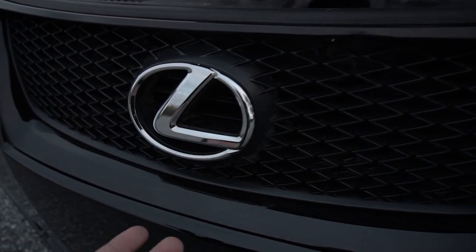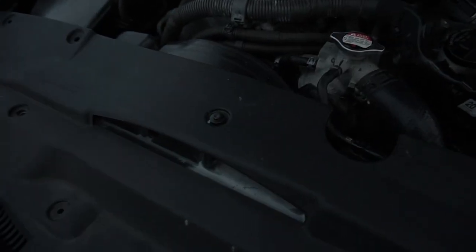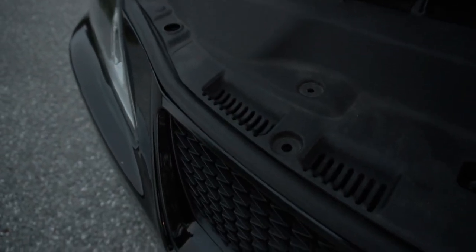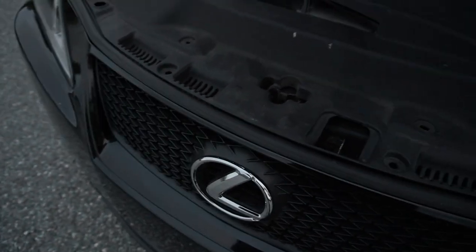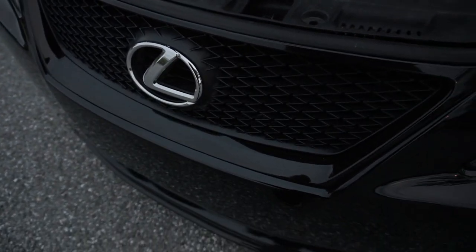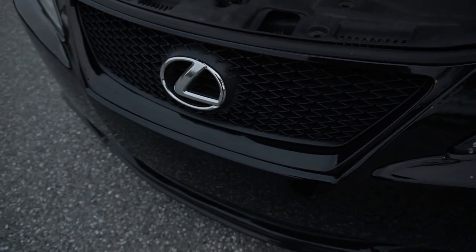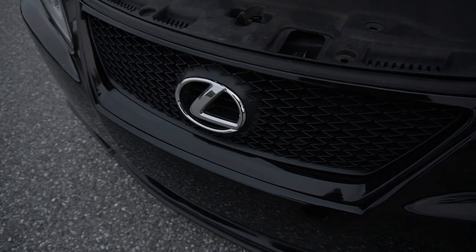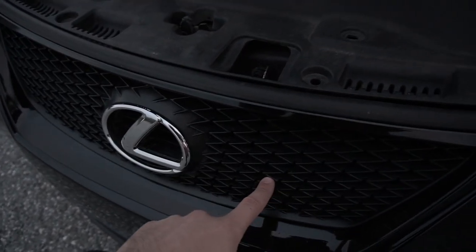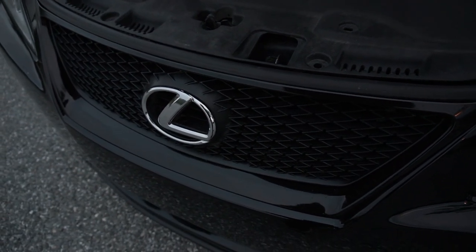To install this you take your engine covers off. I just have one clip holding this in, but once you take the clips off you can see it's held on by clips and screws. You take those off and the whole thing comes off. The bezel and the grill are two separate pieces so you have to order them separately. I'll try to include a link — I did get it on eBay and had a hard time finding it again, but it's available on the Icon Motorsports website, so I'll put some links down in the description.